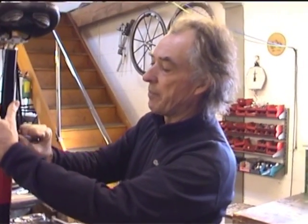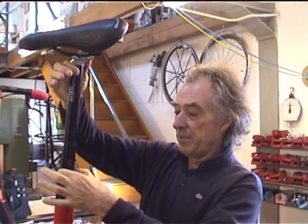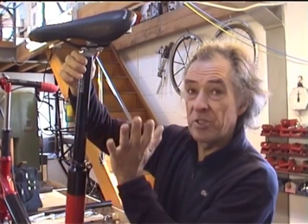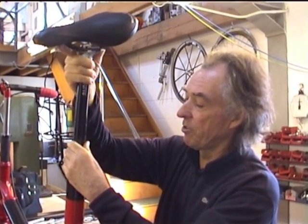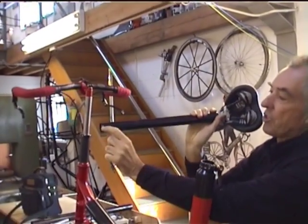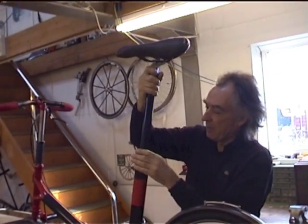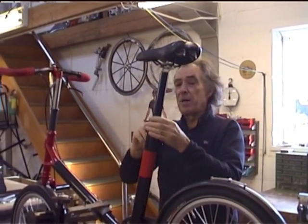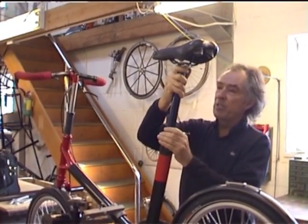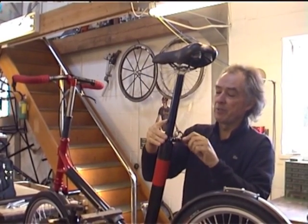Your seat post has got a QR, but people can't steal your seat post because if you pull it up it doesn't come out. You have to rotate it, which is useful because this fat carbon tube doesn't locate it — there's an aluminium top piece and a second aluminium ring down here. If you pull it through that enclosure it would snap off with your weight, but you turn it a bit, find the groove, and it comes out a bit and stops. So you've got a combination seat post with a little tiny screw that just stops it. I went to aluminium thinking it would be better than the carbon one — it scratches off just the same. Their aluminium post is actually slightly longer than the carbon one, so you've got a full 400mm seat post.